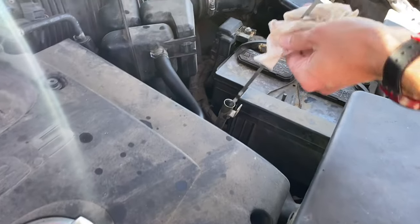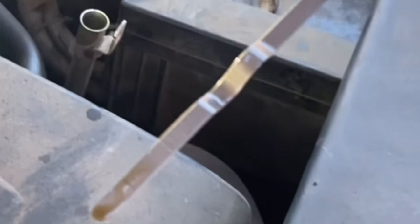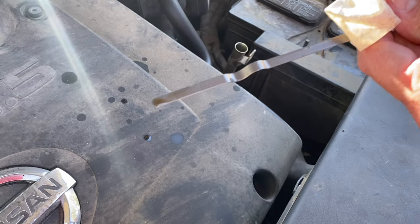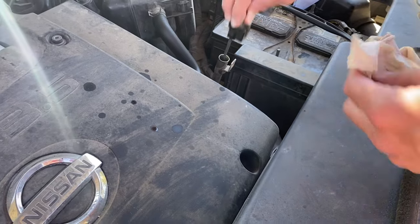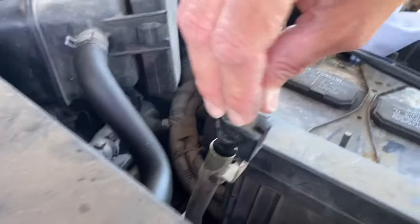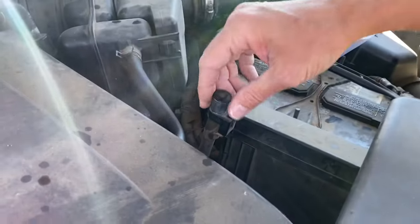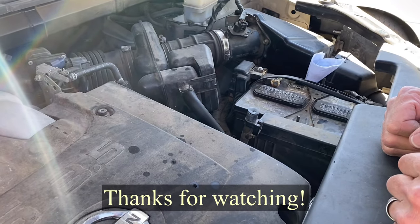It's been about three or four minutes. Let's check it again — we've added about a half a quart. That's more like it. It's right before the top notch; the level's right about here. We're going to keep it right about there, so it only needed about a half a quart. Now we're going to take it for a test drive to see if it fixes the problem. Turn it to where it locks — a lot of you guys will have a lock right here, this one's kind of worn off. Usually it'll lock but you need a screwdriver to unlock, but this one will pop off. Anyway, we're going to do a test drive and see if this fixed the problem.